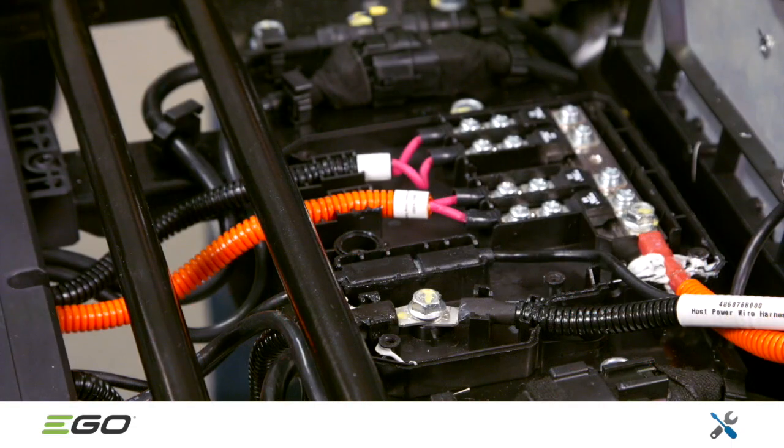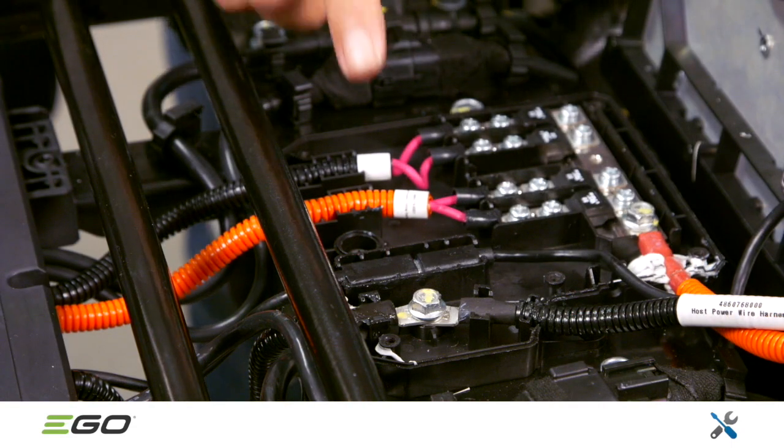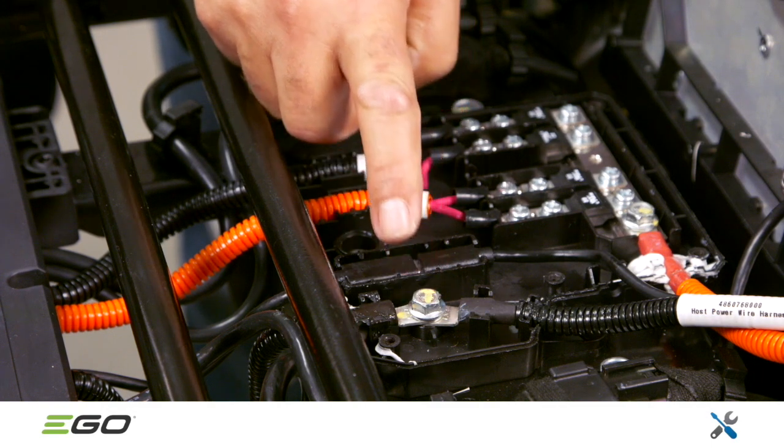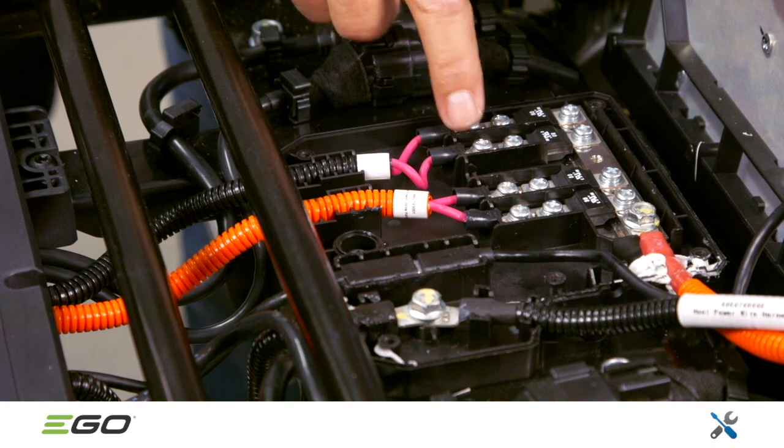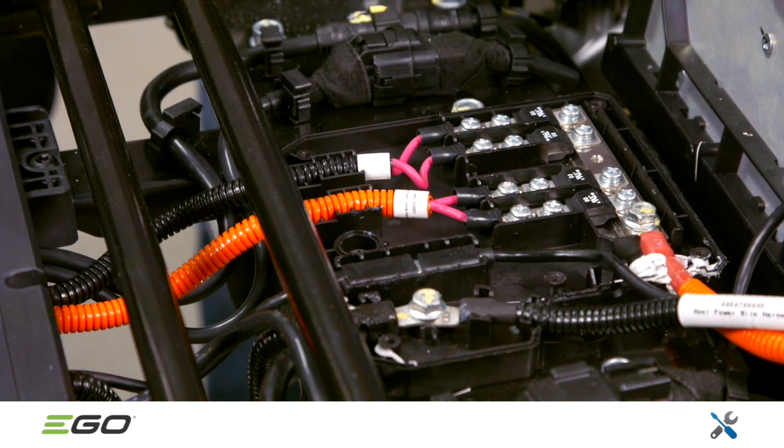The control box assembly is linked to the battery box assembly with a 10 mm black wire terminal, 1 Type-C plug, and 4 positive terminals, secured with Phillips head screws. All of these must be disconnected before proceeding.